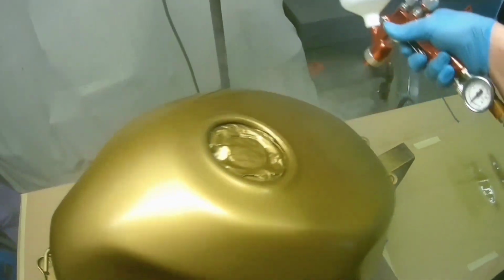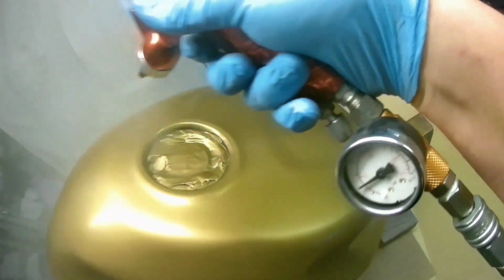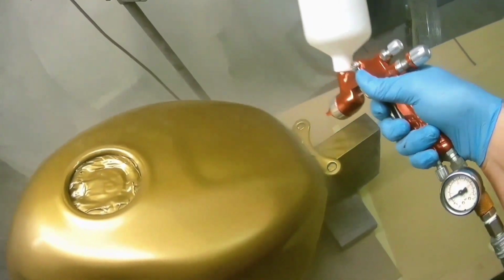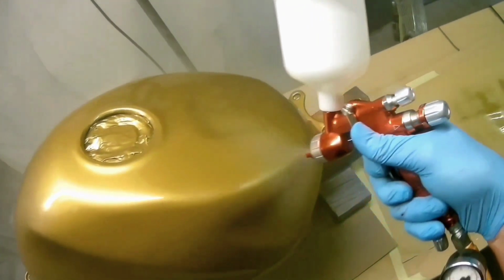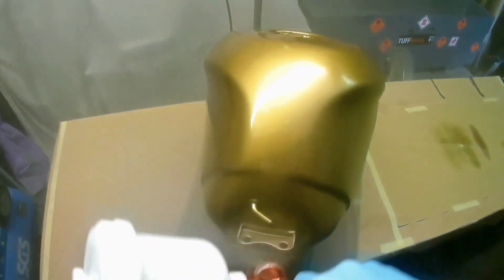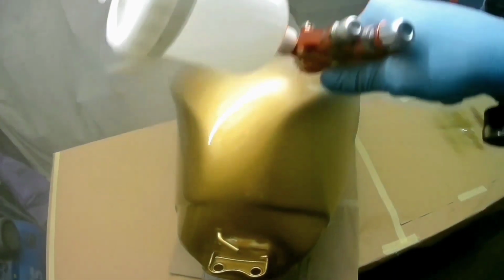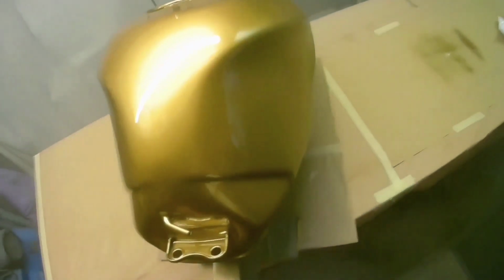a lot of people buy miniguns because they have smaller jobs to do, and they are normally going to be using it in an environment where the air is more controlled. So there'll be smart repairers operating from a van where there's not loads of air. You're not going to have a 250 litre 28 CFM air compressor in the back of your little van. And people spraying at home aren't going to have the facilities for big air compressors, simply because of the amount of current they use, particularly on startup, where the current is quite high.